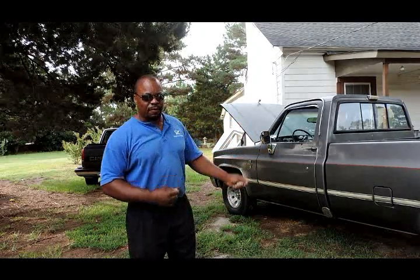So what we're about to do is transfer all the tires from his 91 Chevy pickup to the 87 and vice versa. Also, we're going to flush out the cooling system because it's filled with water and it's starting to get rusty. If you've got a system that's not up to par with the antifreeze, anything metal that water touches is going to start eating out. It's going to start rusting away.